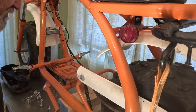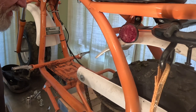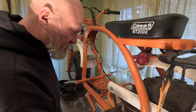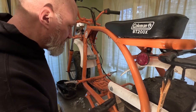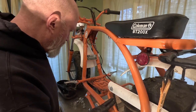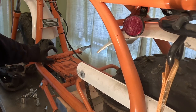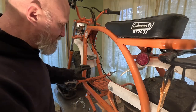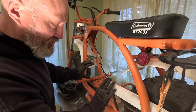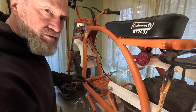I think what I'm going to do is take the bike outside, remove this first, then grind the welds off here. I may use this piece a little later — I haven't decided yet. Then I'm going to build a spacer of about two inches using some rectangular tubing I've got kicking around. That should get me enough height where I can clock that transmission mounting plate and give me some clearance room.